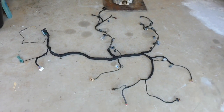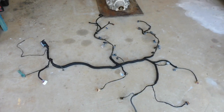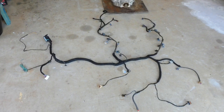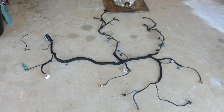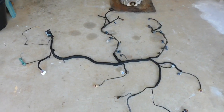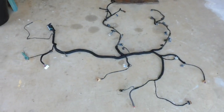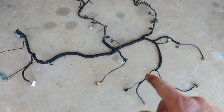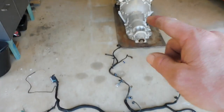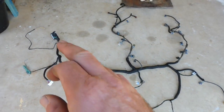And I'll just take you through some of the things he did. Obviously it was a 4L65E automatic that was in the VZ SS. Now it's going to be a Turbo 400, so the old 4L65s, or if you've got a 4L60, they're all fully electronic driven. Heaps of electric solenoids, whereas the old Turbo 400s, there's no electrics inside there. So normally down the bottom here there would be another big plug that goes into the side of the shifter selector on a 4L65, and a whole heap of wires that come up through the loom up into the plug for the ECU.